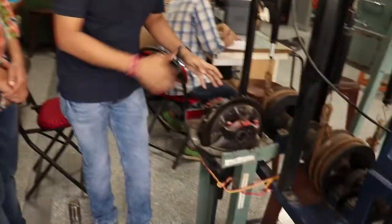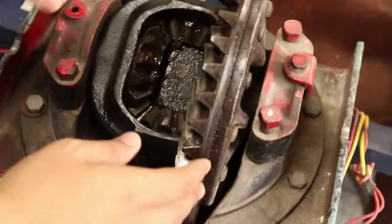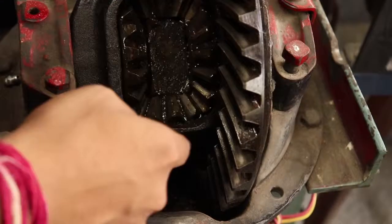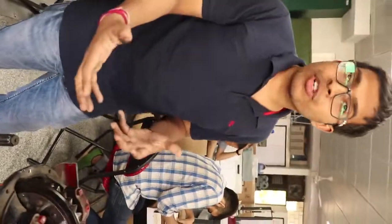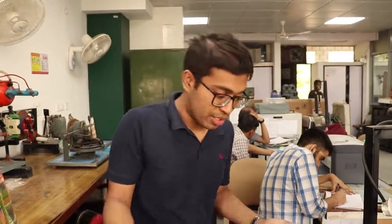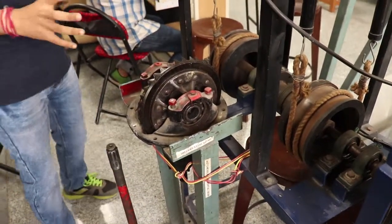In the previous two sections of the video, we looked at the gearbox and the compound epicyclic gear train. Now we know that for proper rotation of the tires, there is a need to have different power at different parts of the axle, and that power differentiation is done by the differential. This is the basic structure of a differential — these are the gears of the differential. It has four different gears in the middle portion, and we have two shafts here that go to two different wheels. Depending on the torque requirement, there will be power distribution to both wheels.